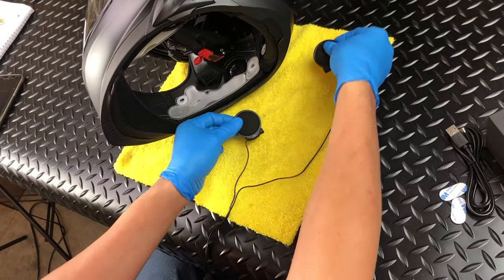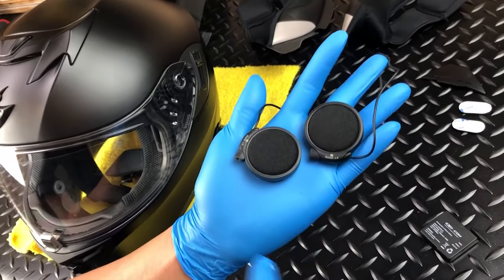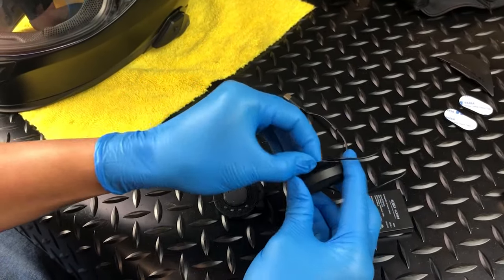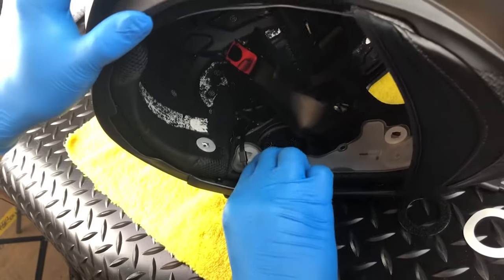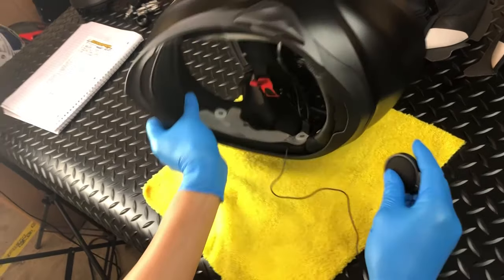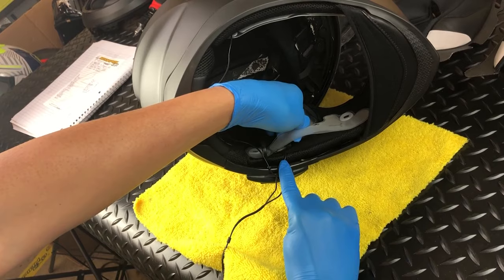Note that the speaker to be installed closest to the control unit has a shorter speaker wire. You might also have noticed that there is no boom mic — that's because the microphones have been fully integrated into the Exocom speakers. First, separate the Velcro ring from each speaker. Then, one at a time, remove the protective backing for the two-way tape and install the Velcro rings into the speaker cavity. For helmets featuring the AirFit system, be sure to slide the speaker between the air bladder and EPS before attaching them to the Velcro. With this done, simply install the speakers ensuring that the integrated microphones are positioned towards the bottom of the helmet.